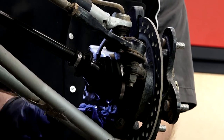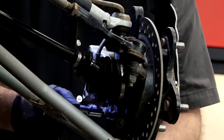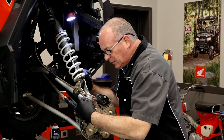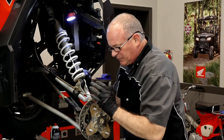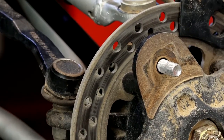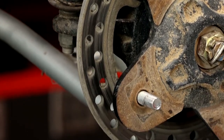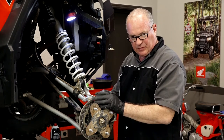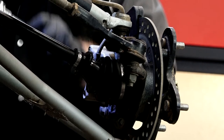I've already got it mounted back up, but if yours were worn as viciously as these were — it looks like I got lucky looking at the condition of the rotor itself. It's actually still pretty smooth. It was just right at the point of failing, so it had not started to damage the rotor. Had they continued to run it, eventually they'd be metal on metal and we'd be replacing the rotor as well. But that didn't happen to this one, fortunately.